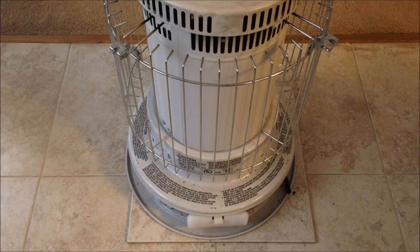One of the things you may have noticed when you run these kerosene heaters is if you ever end up shutting the thing off without all the fuel being run out of it, the wick ends up becoming charred. By charred I mean the very top of the wick where the kerosene burns from is actually hard and crusted in black, and basically it makes it damn near impossible to relight. You have to take a wire brush and brush the top of the wick to break up that carbon buildup, because there's no other way you're going to get the kerosene heater to light.